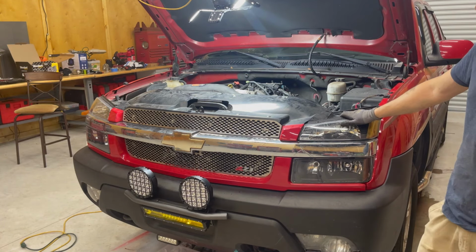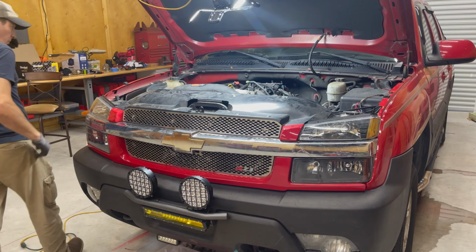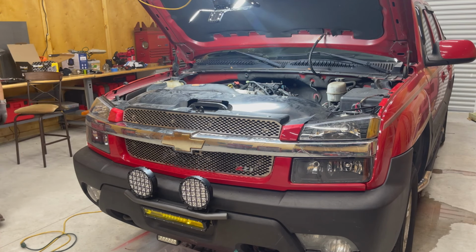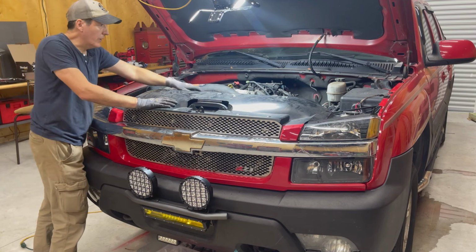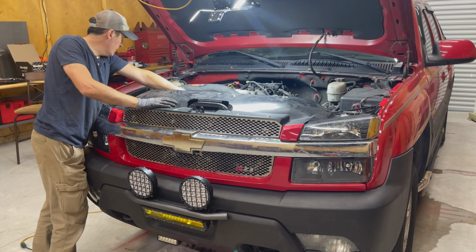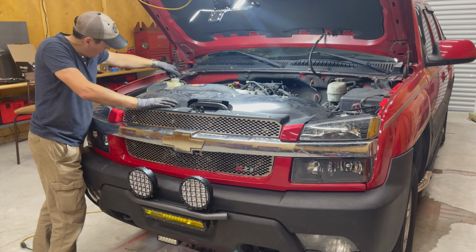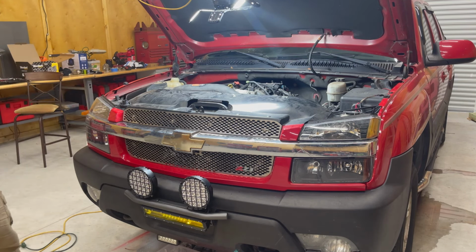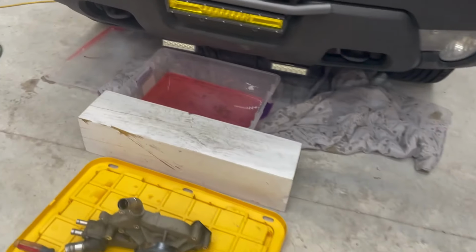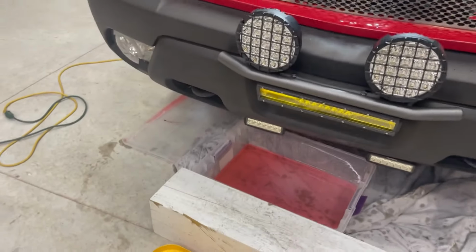The new water pump is in, and now we've got to add coolant and run it. And very important, you got to watch the temperature. You could have an air bubble in the system, and I think what they call it is burping the system. You may have to do that, but I will not be reusing the antifreeze that came out of it. Although, to be honest, it looks very clean. I don't know why it's pinkish purple. Maybe somebody knows that. Somebody may have experience with this.